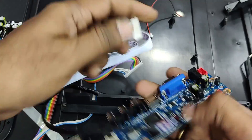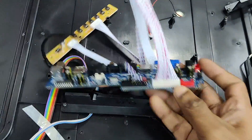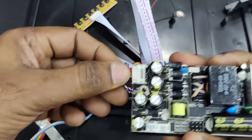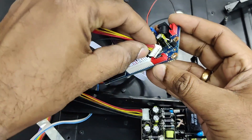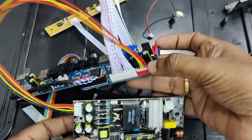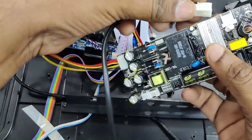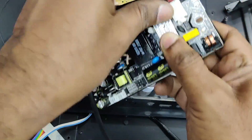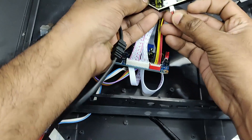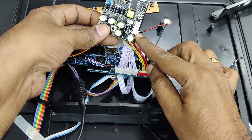The white connector is for keyboard and IR connection. Use the connector that comes with the board itself — it is a single connector at one end with two wires, one going to the keyboard and the other to the IR. The SDL 129C power supply board has a connector — plug it in and the other end goes to the red connector of the V56 board as 12-volt DC supply. The center connector on V56 is for audio, so you can connect two speakers directly. Then provide AC supply to the power source and connect the backlight driver connection using the two-wire connector.